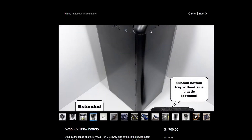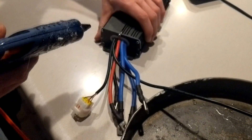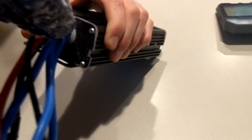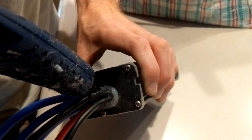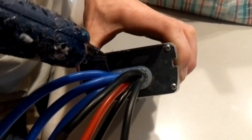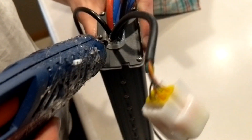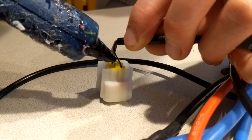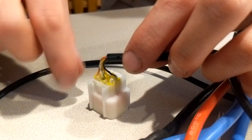The first thing I did before putting the controller on the bike was look at the bottom where the wires go into the controller. There's a little rubber piece meant to keep mud and debris out. I ended up hot gluing around that to make sure it was water-sealed tight. The controller is supposed to be waterproof but I'm cautious — I just ran hot glue in and out of the wires. I also hot glued the communication cable for the motor.